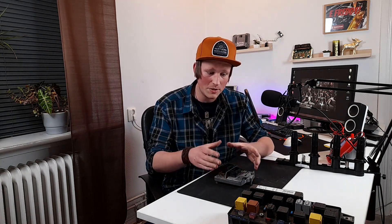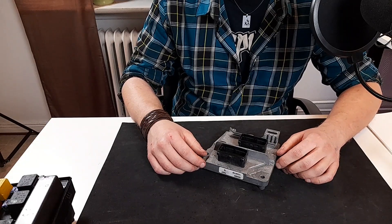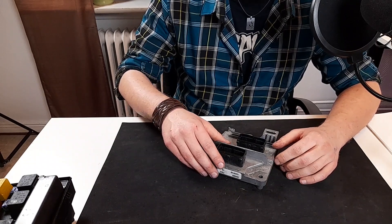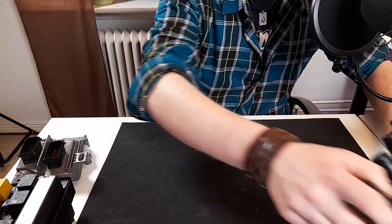This specific ECU can be found in vehicles from around 2003 to 2013-14, and to be honest it's not very uncommon to find broken ECUs on older Opel cars, but this specific one, the MT35, is different. Most commonly you get the P1600 fault code along with various ignition coil fault codes, and this 9 times out of 10 points to a broken or partially broken coil pack on the car.